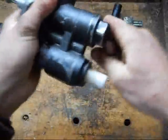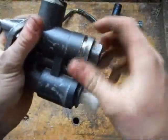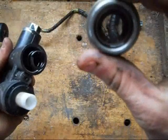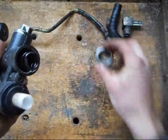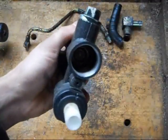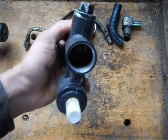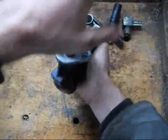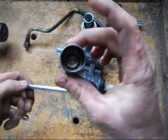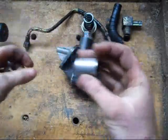Okay, it's loose. You got this guy — the first little bit he's got a spring that's pushing up against him, so it's a little hard to go by hand. It's loose so it's not going to fly out. Spring. This guy is just a screen. You can see there's a check valve in there — that's actually the plunger. To get that out, you hold it in your hand and just give it a tap like that. Out comes the plunger. There's your plunger — you can see the check valve. Very simple. No O-rings or anything — this is all metal on metal.